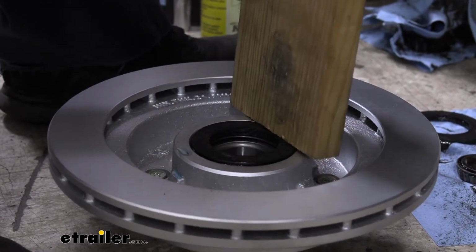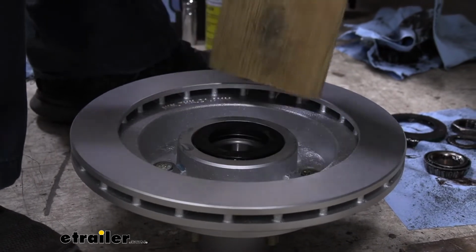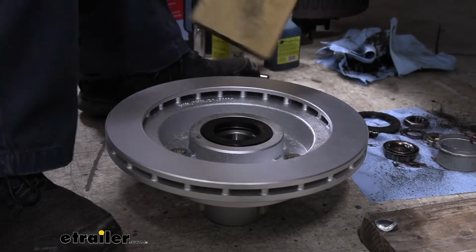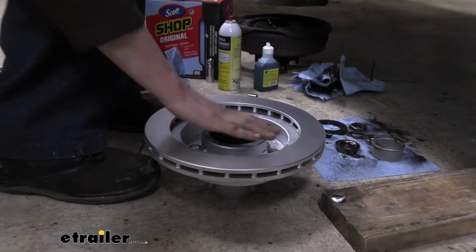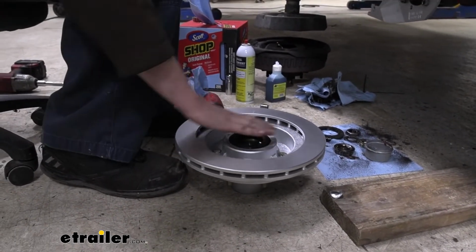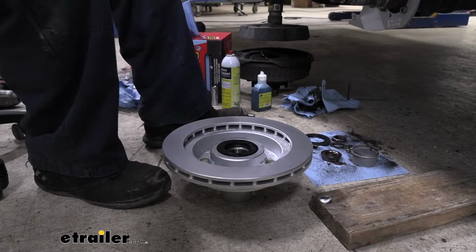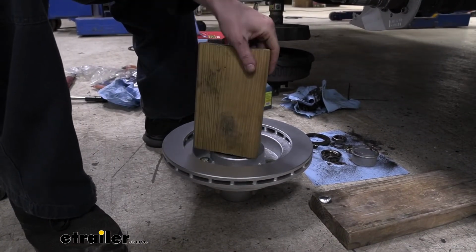And now, you guys at home that probably have mechanical experience and have serviced your brake assemblies before, replace bearings and seals. Normally, once you get the seal driven in there flush with the back, you think, okay, well, I'm done. I got a little spot here that's still raised I got to get. But usually when you get it flat, you think, hey, I'm done. But actually on these disc brake conversions, it needs to be driven in further than flush. So we're gonna get it flush first.